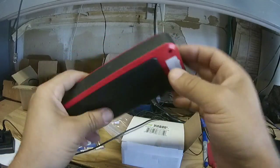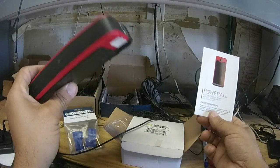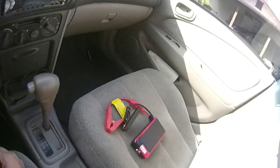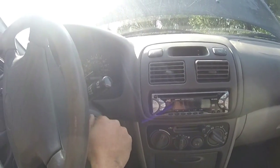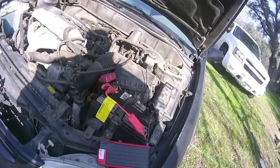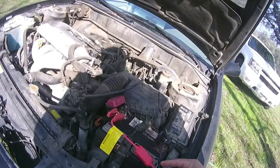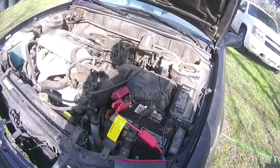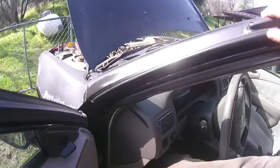Currently this is the hub of all my powering needs — this is a Power All portable power bank and battery jump starter for small engine vehicles. This car hasn't been used much, just weekend stuff, and it's been in storage. It's got some juice but not enough to activate the starter. As soon as I crank the engine over I have to take this off immediately, because too much current feeding back into the lithium batteries could cause them to explode.